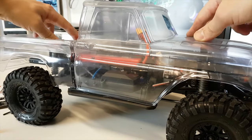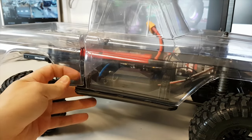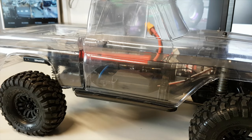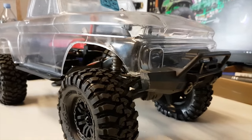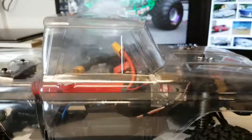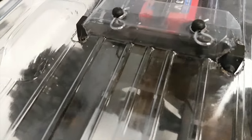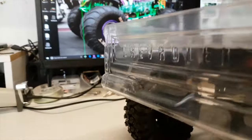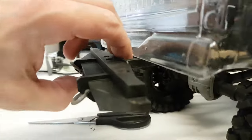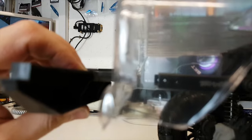That's better. Still going to cut a little bit out of the body here so it sits down a bit lower. But at the back here, just come down a tiny bit - that's looking good. Do the same on the other side. So that's all mounted up now. Really happy how the front's come out, the side steps have come out good, front body mount's perfect. Rear body mount - I just cut some little holes in the back bed here to make that fit. Back bumper guys, let me know what you think I should do here. I think if I buy a front mount and put that on the back, that might be the trick. Height wise I think that wants to end up so those mounts line up straight with the chassis rails. Might have to make some - don't know yet.